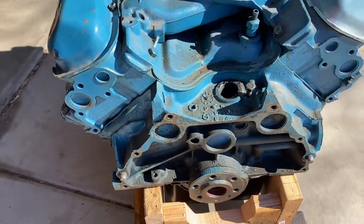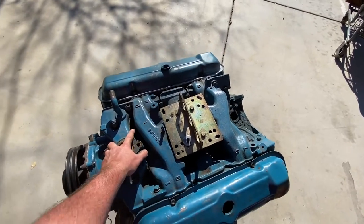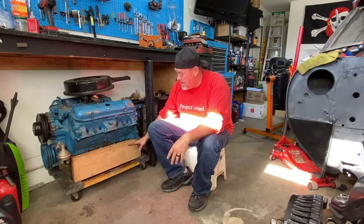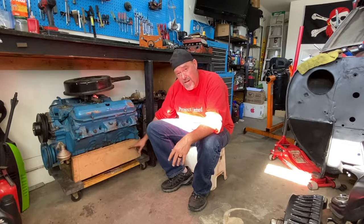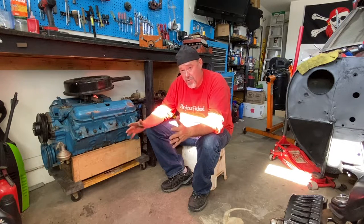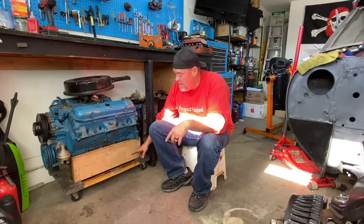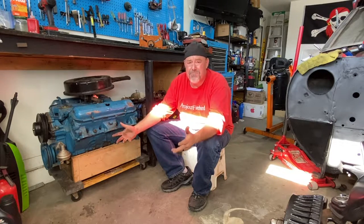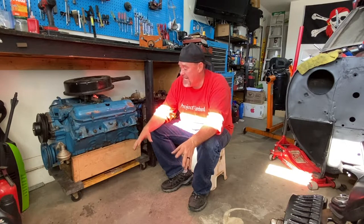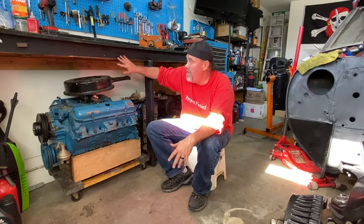Plenty of room all the way around it, and we can now move it around virtually by hand. The Pontiac 326 is on the homemade DIY engine cradle — those are just two-by-eights, 24 inches on both sides, about 10 to 11 inches in between the two boards. That way it sits right on the oil pan lip on both sides. We attached it to a Harbor Freight furniture dolly — probably 25 to 30 bucks total in materials.